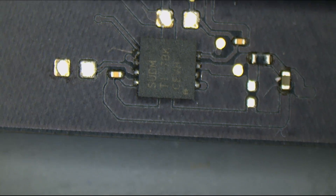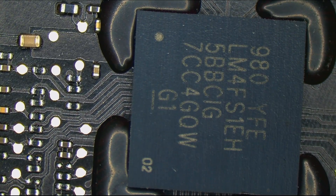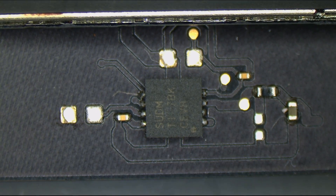Let's take a look at the rest of this board by taking it out of the case. The pull-up resistor for SMC reset looks fine. The SMC reset chip also looks fine. So we have two possibilities: behind door number one, the SMC is shorted and pulling it down; behind door number two, the SMC reset chip is bad.